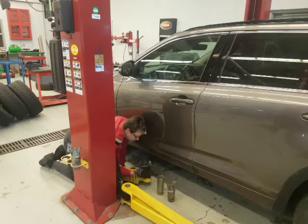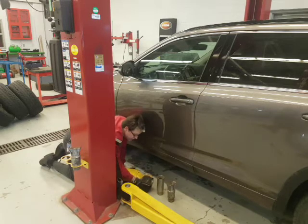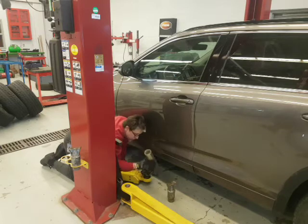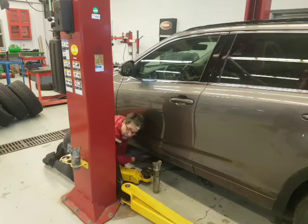I like to use this so we don't knock the paint off or fold the crease, so this is great for unibody. And these go up and down, so we get the right height. I like to set them about 1 inch away. If we have a taller vehicle, we can use a stack adapter. We can stack them up to get taller, so we can clear running boards.